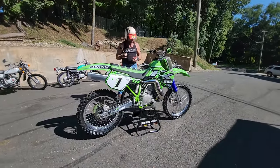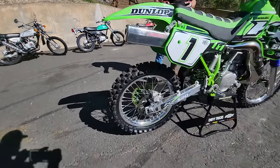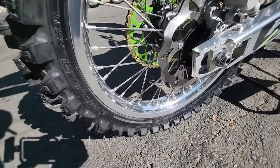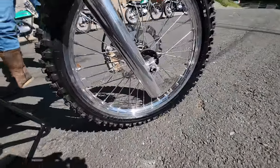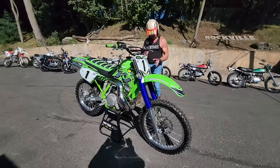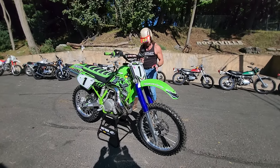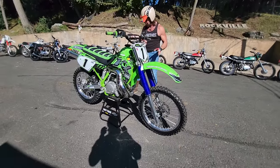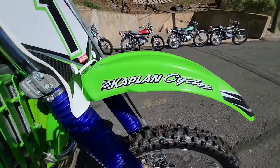They took the wheels completely apart, took the spokes out. The hubs and the rims went down to Carlos in the detail shop. He hand-sanded and polished these original Kawasaki, original date-coded 1989 rims — polished them like chrome, polished the swing arm like chrome. It took 13 hours. They look like they're chromed, but that's polished aluminum. Very easy to maintain — use Pro 40, put a little shine on it after every ride, takes 20 minutes. The hard work is sanding down the original factory clear coat and polishing the rims until they shine like a diamond.